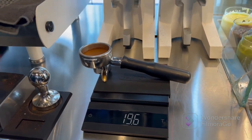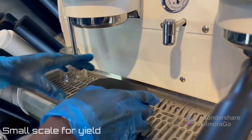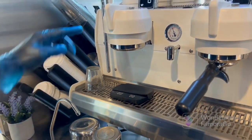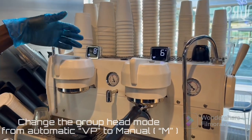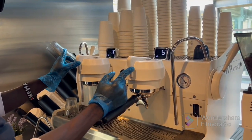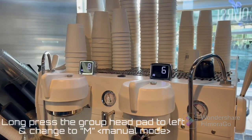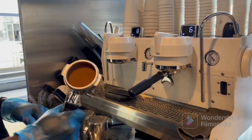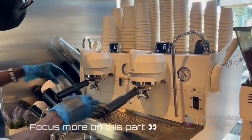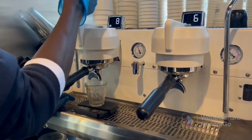I'll take the small scale, which is this one, and set it over here. Make sure it reads zero, using this for calibration. So what you need to do next — this is the VP. We need to turn it into calibration format. I'll make sure I set all the group heads to M, then press the left on group one. I'll take my portafilter with my dose. This is the crucial part — it's supposed to pop up on this one. Then I'll take my cup and put it beneath here, then tare my cup, and start the coffee.